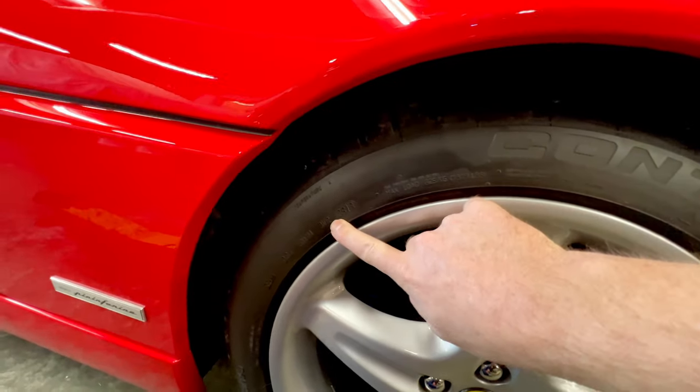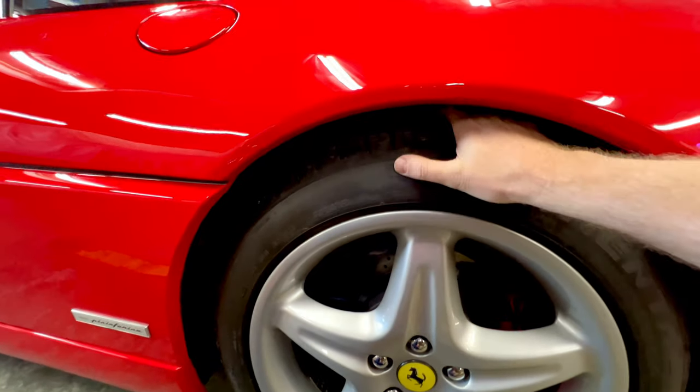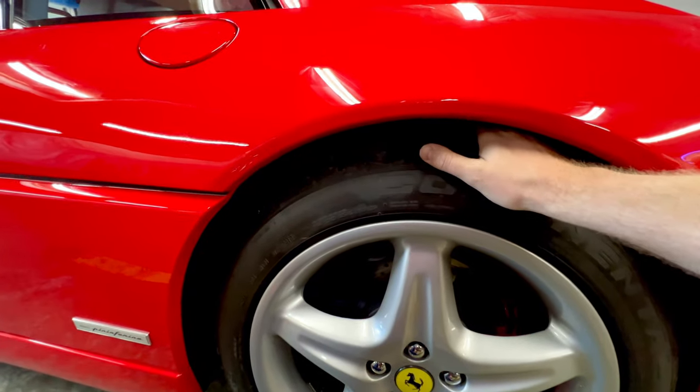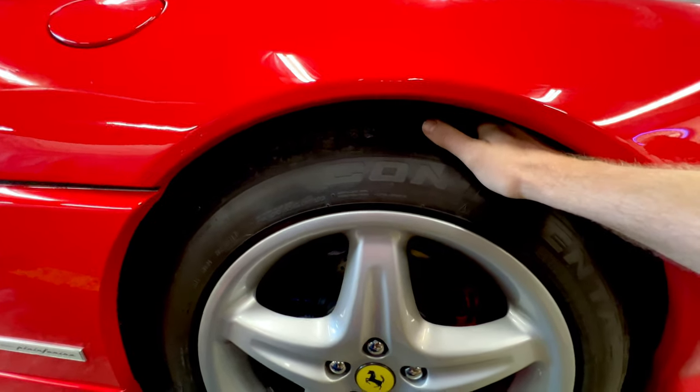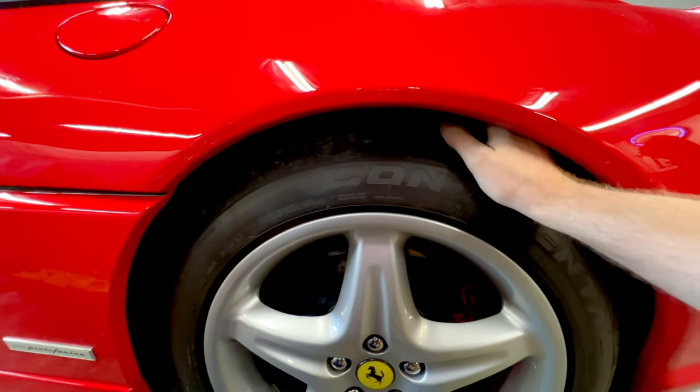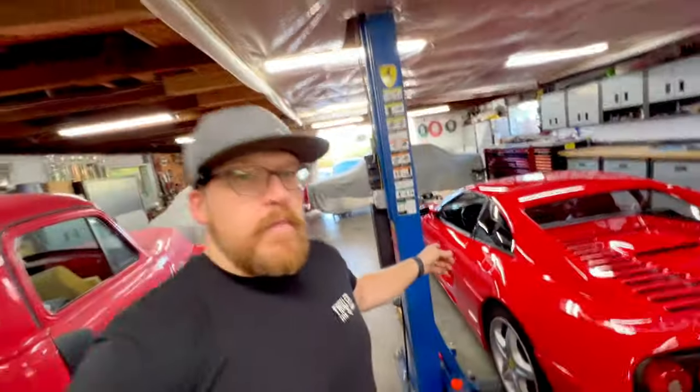So our rear tire back here is 3813, so this tire is even older, and I can tell that these tread blocks are actually pretty stiff and pretty firm as opposed to the front. The front weren't too bad, these back ones are pretty bad. Now, a good general rule of thumb is you want to replace your tires when they get about 6 years old. There is some leeway depending on how the car is stored and if it's heated or not heated,